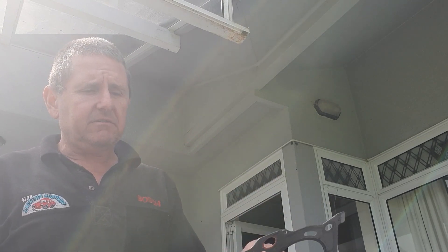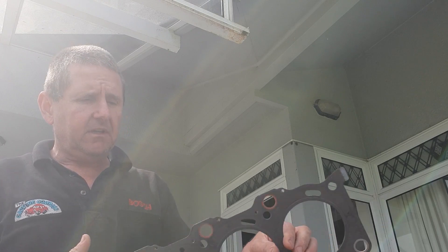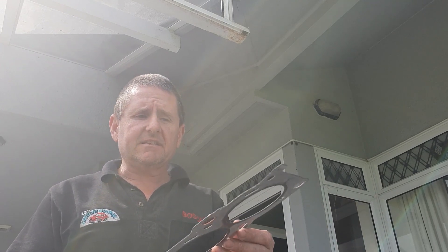Your composite graphite type gasket is good for standard NA engines. I've actually offered to take the standard composite gaskets out of this kit for the customer and I'm going to swap in some steel gaskets.